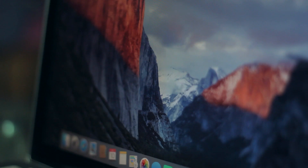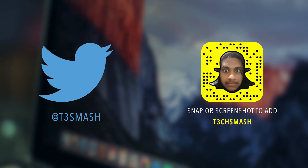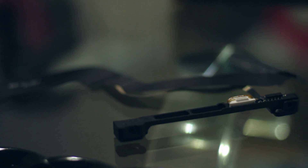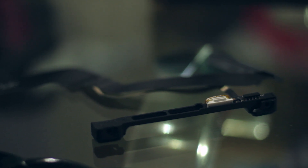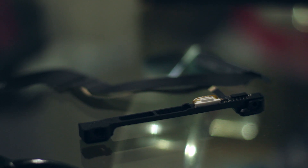What's up guys, I'm back. If you haven't seen my latest vlogs or aren't following me on Twitter or Snapchat, basically I thought my very expensive SSD was gone — but that wasn't the case. It was actually the hard drive cable, which is a pretty common issue among mid-2012 or earlier MacBook Pros. If you'd like to see a video going over why this happened or how to prevent it, let me know below — but if yours already failed, here's how to change it.